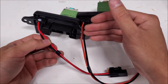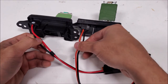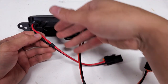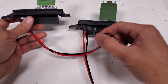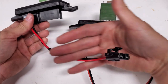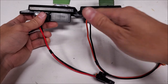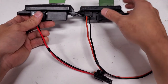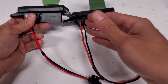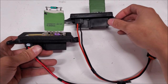It's possible the wire gauge inside could be the exact same, but just by handling it, this wire is thicker than the other one. So in theory it has a thicker and obviously shorter wire — that's what I like to see. When you have a shorter run, you don't experience as much heat. The generic one might be longer because they use it in other applications, but since this only works in GM vehicles, it's probably a little bit out of spec compared to what the manufacturer wants.